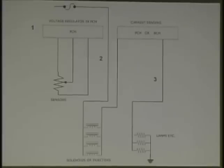If you got no injector pulse, what's the first thing you usually go to? Crank sensor. And you go in the wrong direction. Now you start putting a crank sensor in or cam sensor, and guess what? Ain't working. You've got to look for the solenoid that's pulling more than the 1.2 amps, so we can put our amp clamp on here. Careful if it's fuel injectors, because we can hydrostatically lock the motor if we supply the ground to all four of them at once. But if we put an amp clamp on here and ground one at a time, we could see what the amperage is to each injector.